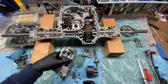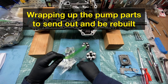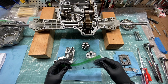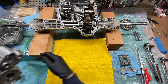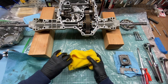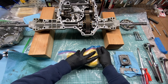This transaxle ships from the factory with a 10W30 base oil that is conventional, not synthetic. Over the years, TuffTorque has changed their replacement oil recommendations as they've iterated on their own custom oil formulation, which they now refer to as TuffTec. Originally, their replacement oil for the K46 was a 5W50 synthetic base. Their latest formulation is now a 10W30 synthetic base. When I say base, I'm referring to the fact that TuffTorque has formulated their own brand of oil with additives they've determined to work best in these transaxles.